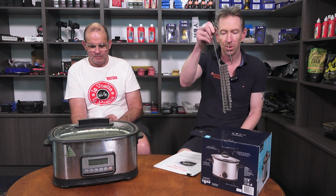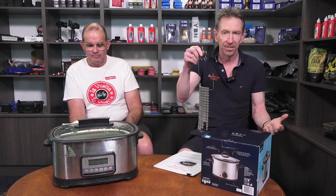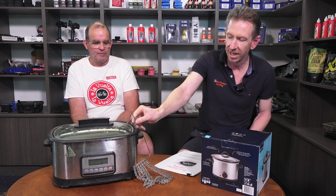If you've got questions about immersive waxing, and it does lend itself to a lot of questions, on the surface a lot of people think it's complex and takes time. It's super, super easy. Immersive waxing is basically you pop the chain off your bike, thread it onto a swisher tool, pop it onto your slow cooker pot and turn the pot on low. You come back later, swish it around, hang it up to set, and before your next ride you break the wax bond on the links, which we went through in, I think, episode 4. We demonstrated how to do a waxing, reinstall the chain and ride. 99.9% of immersive waxing is just that.